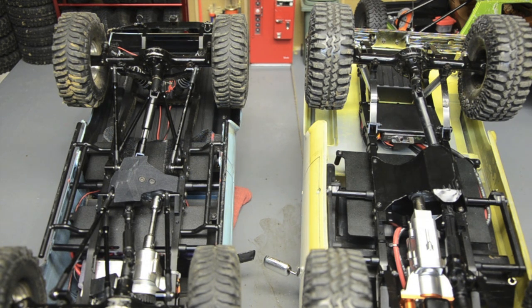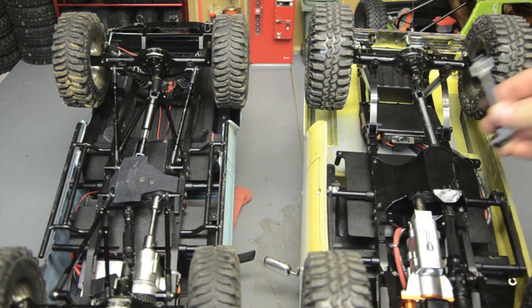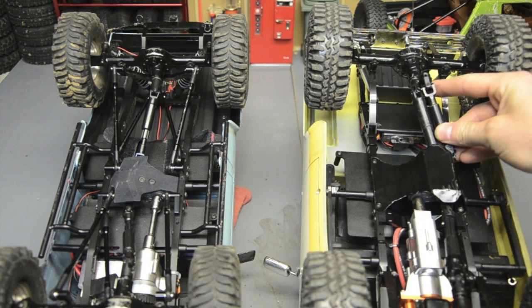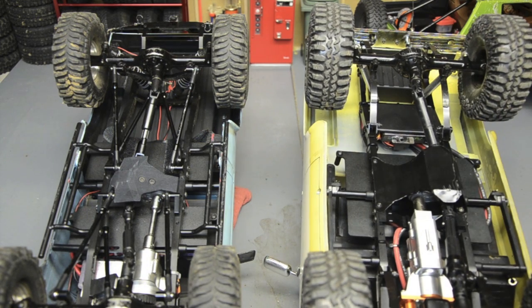I bought those for the Blazer, knowing that because the R4 transmission relocates the transfer case, I would need that. But another problem, it's too long for the back. Because the R4 is long, it makes the front drive shaft overextended, the rear too long. So, easy solution. I've got both.